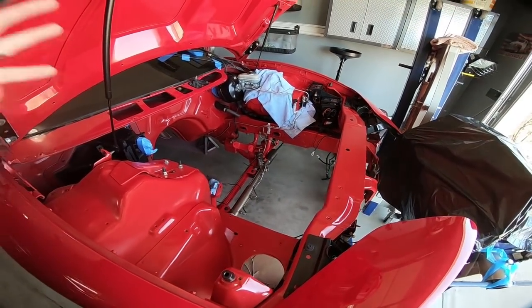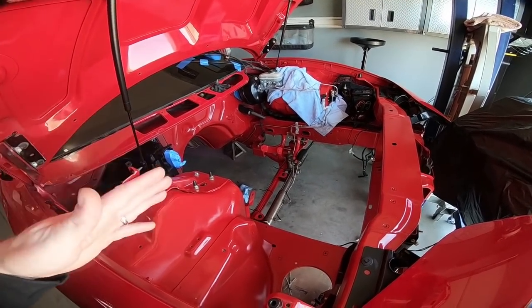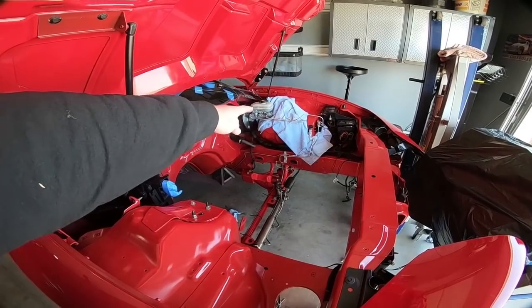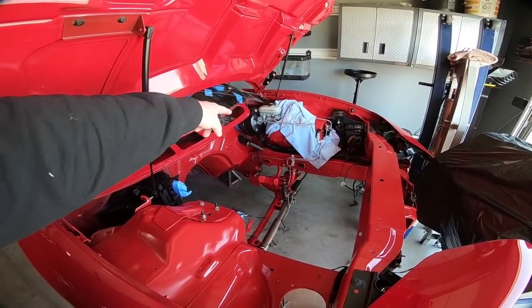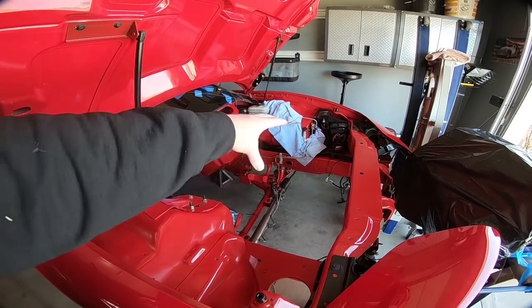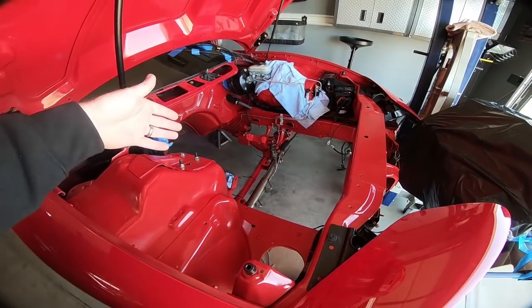I will say this has been the most tedious and hardest part of this whole adventure — just that brake line bending. You bend a line and it's not where you want it, so you have to redo it. The kit does a decent job getting things into the places you want. Those pre-bent lines are great. I probably wouldn't run them over the fender like they do, but I'm sure they're allowing for room in other places. A buddy of mine ran his on the backside of the fender — at least the proportioning valve — which looks really nice. If I were building the kit from scratch, that is probably what I would do. I will list SJM's info down below. We still got zip ties to trim up once I make sure nothing is leaking. If you guys are enjoying this content, smash that thumbs up button, subscribe, and ring that bell icon so you're notified every time we drop a new video. Stay tuned because we have way more to come on this thing.